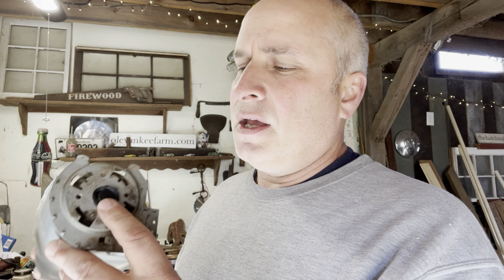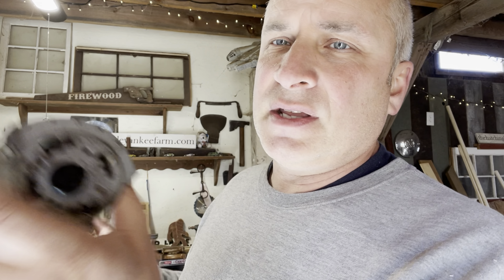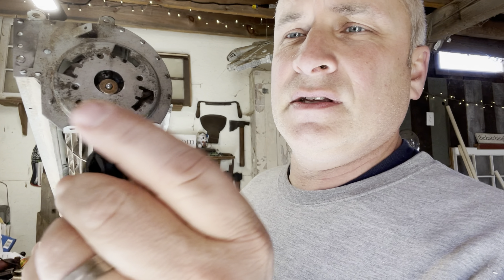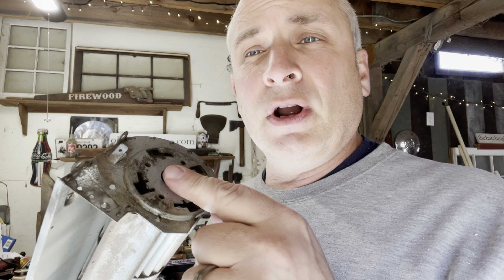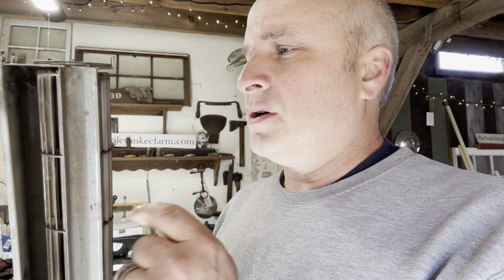This one in particular starts squealing really bad. This rubber piece here is what actually holds the fan in place. If you pop it out — I damaged mine, and that's one of the reasons I had to replace it, but it was already starting to get loud. That's what it sits in — it sits in this rubber cap. I greased it, put oil in it, put it back on, and it worked for a while, but it was still making noise. I had ordered a brand new one for just under a hundred dollars and it's now perfectly silent.